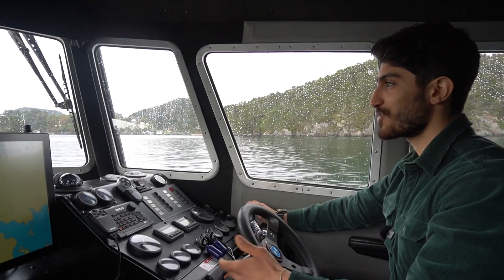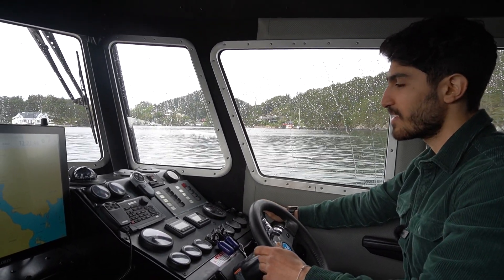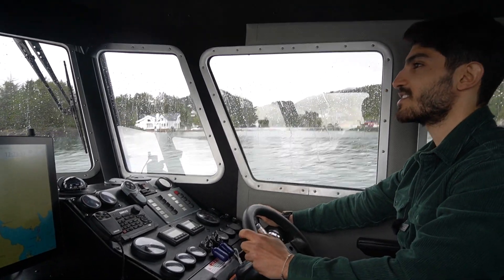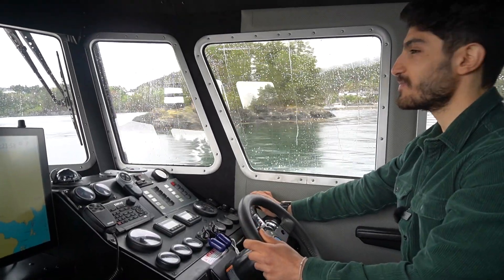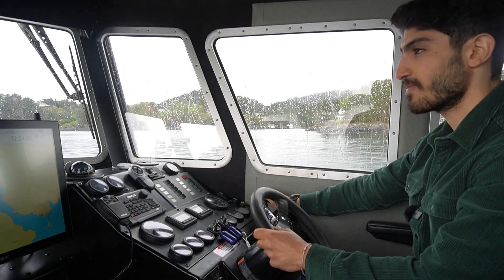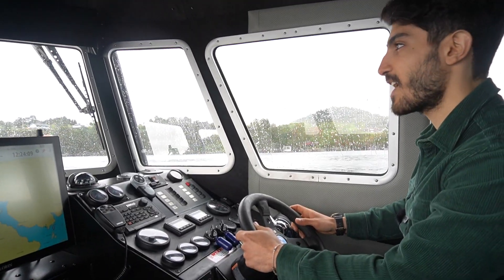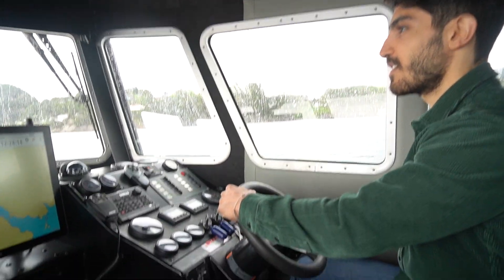The acceleration is really picking up quite fast and nicely. We're going around about 3,000 RPM and we're already over 30 knots, so speed is not a problem on this boat. It should rev up to around 4,000 RPM, but we're nowhere near the limiter.